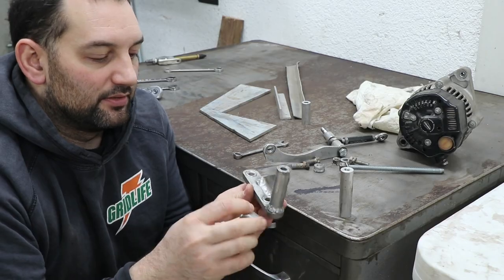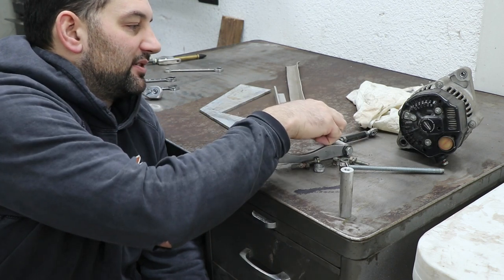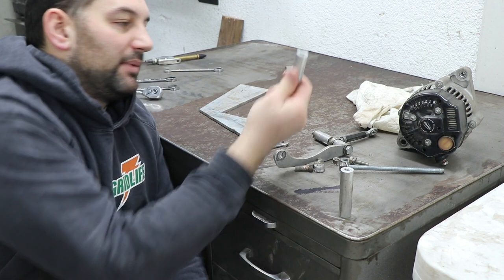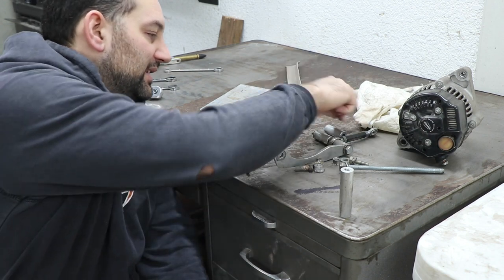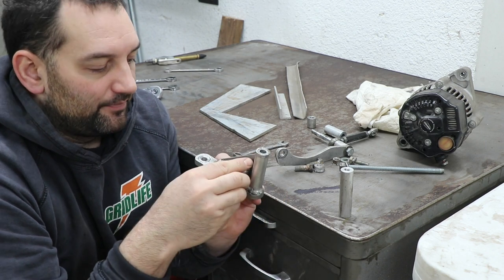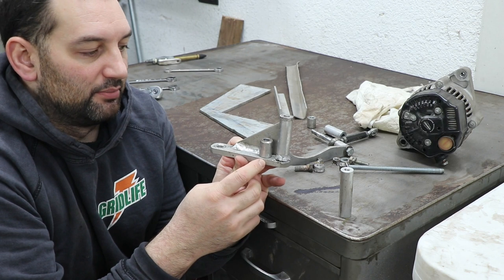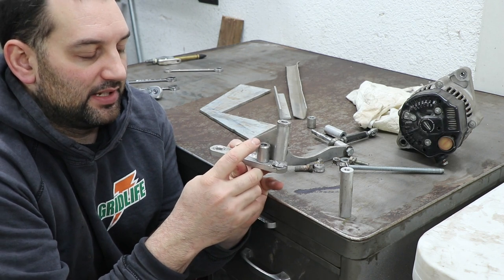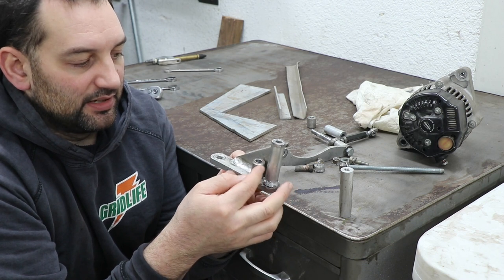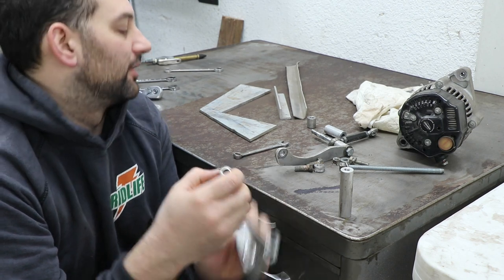And another thing I might do is take one of these shorter spacers, because I had some stack spacers here on the other side of the front bracket. I made a longer one so I can make a single piece out of that. I'll have these two shorter ones that I can possibly add to this other bolt hole and make another standoff, where I could drop a piece of aluminum in here and just kind of bridge this gap and make it stronger yet in this corner.